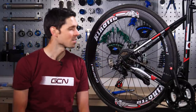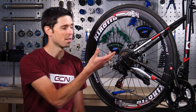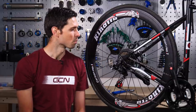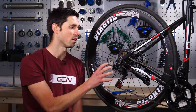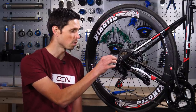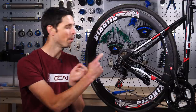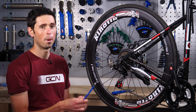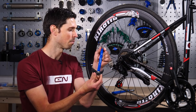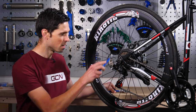Something that I quite often see people struggling with is removing the rear wheel from your bike. I know this isn't specifically a maintenance task, but it is particularly helpful if you want to do some other maintenance tasks on your bike or just remove the wheel to make cleaning that little bit easier. Many bikes will use a thru axle or a quick release system. However, slightly cheaper or older bikes like this will use a solid axle. I said you're only really going to need Allen keys, some Torx keys, or some screwdrivers, but surely everyone has a spanner set at home. If you haven't, you can just buy one 15-millimeter spanner for only a couple of pounds, or use an adjustable spanner to fit the size of the nuts on the solid axle.